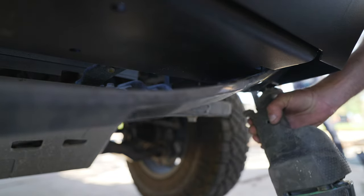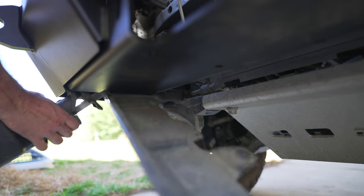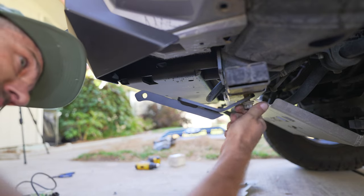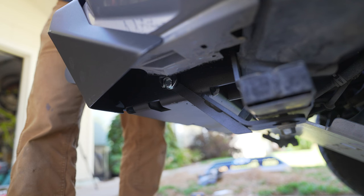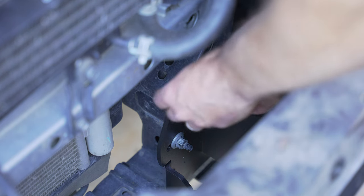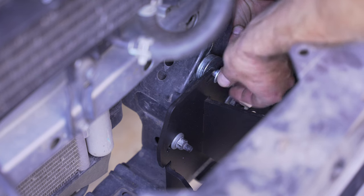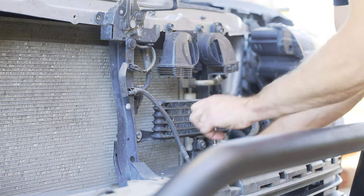This last piece of plastic goes all the way across underneath the bumper. The instructions say you only need to notch it, but you definitely have to cut it off — or you could leave it looking like a big fat lip on the bottom of your car. The bumper has braces that tie into an additional point on the truck to allow the bumper to be strong enough to pull the vehicle. The last step is they add a fourth bolt for the frame, but since there's not already an insert there, you have to put in a spacer — two washers — and then finagle that nut onto it. I struggled with this quite a bit because you can't get your hand in there.